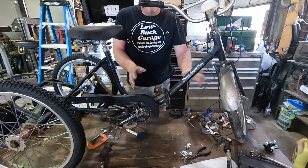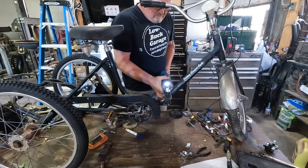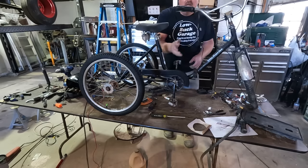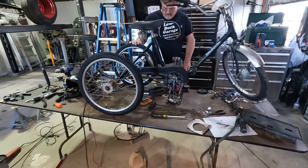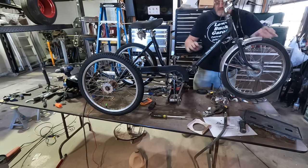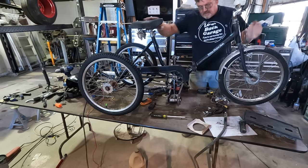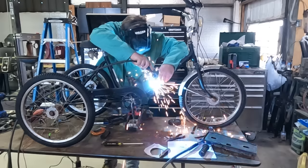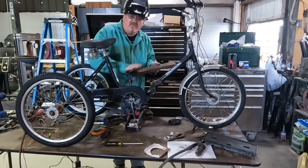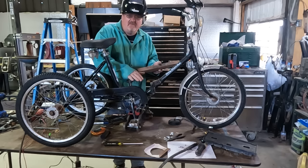There's one more thing I need to do before buttoning up the wiring — I have to saw the bike in half. These pedals are far too close to the ground, they sit way too low, and my feet drag. After cutting, they've got a lot more ground clearance, though the front tire came off the ground — so I just adjusted that and now the front tire is touching the ground. All I have to do is weld it back up. I'm also going to steal an idea from the AdMotor bike: they put a floorboard to rest your feet on in electric mode. I'm going to weld a piece of channel to connect the two frame halves — it'll strengthen things and provide that floorboard.